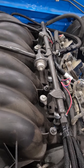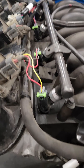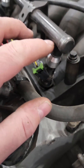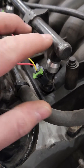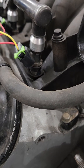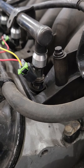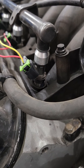For whoever is doing this, I recommend getting fuel rails — I think I'm going to run into issues with leaks with these fuel spacers. There's not a lot of space inside here; there's a very tiny hole that this goes into, so these spacers pretty much choke the fuel off. That's an LM7 truck injector because the LS1 injector is a lot taller. So another option is just to buy LS1 injectors, or try and find an intake manifold that has the rail with the injectors already with it — that's my recommendation.